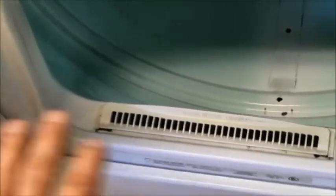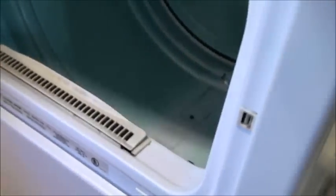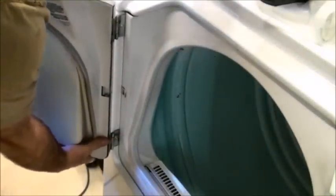You can take and remove these, remove these, and put the door hinges on this side of the door and then change this over. This is the catch for the door that keeps it closed, and there's also a catch on this side, so the door can be reversed. We'll go ahead and remove these with a number two Phillips. The door just hangs there — just lift it up and pull it back.